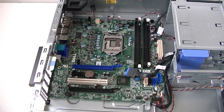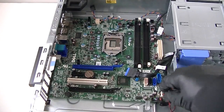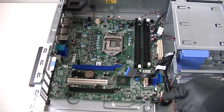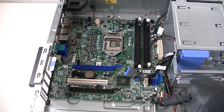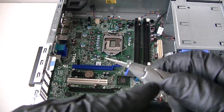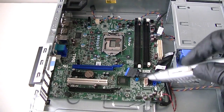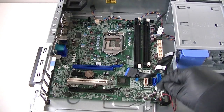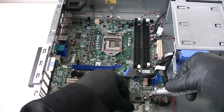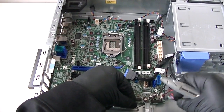Be really careful with the front panel cover for the USB front panel, which connects to the motherboard in the right corner. You need a knife or cutter and a flat head mini screwdriver. Press up the clips on top, press it down to release, and the front panel releases — otherwise you'll break off the secure locks.